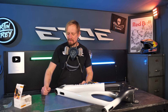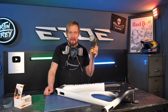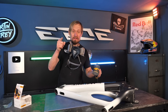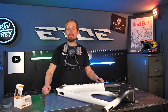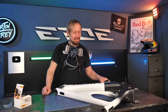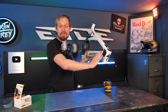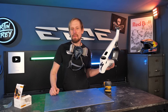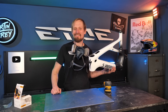The last thing I'm doing is using a rotary tool to smooth the edges of my patch — 120 grit on the rotary. You have to wear a respirator when working with carbon fibers because they are toxic for your lungs, so wear a respirator when you sand carbon fibers. That's it — my patch is done, ready for some primer and paint. But that's another story and another video. Just check all my custom painting videos on carbon bikes if you're interested.